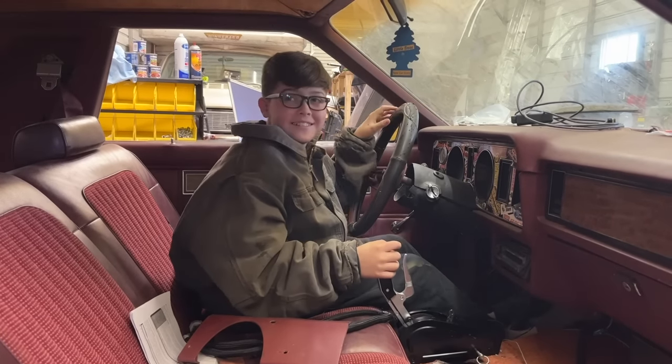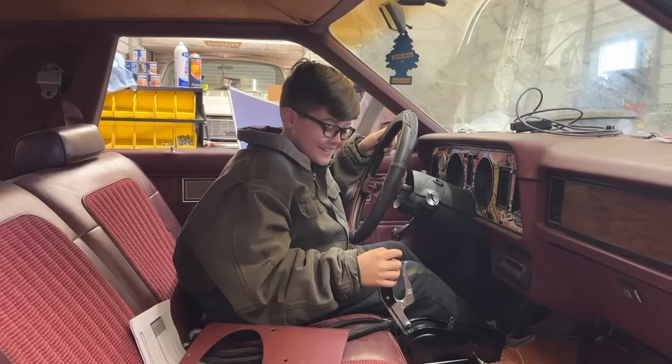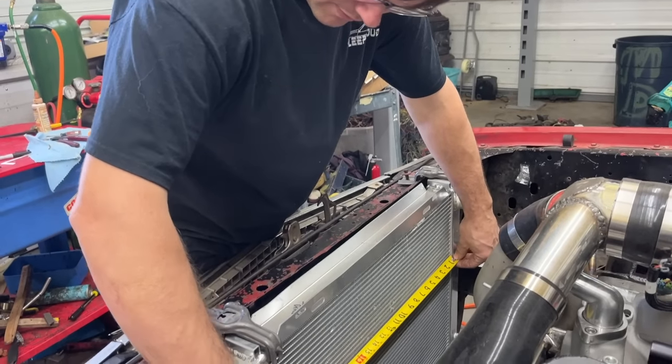I think your converter's too loose. You don't have enough RPM drop. Okay, sorry. I guess now we're gonna have to find us a fan.